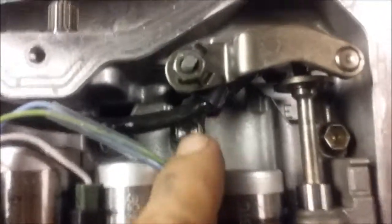I found that this wire bracket works so much better if you turn it around — instead of it being this way, turn it around facing this way. So it holds that wire away from the linkage; it does not allow it to touch the linkage or be rubbed on by the linkage. It does have a gap between it and the linkage rod when you put it in that way. Now it's holding the wire in such a way that there's no way that wire can get over here and get into the linkage.